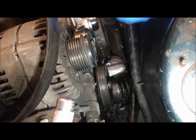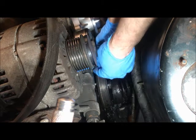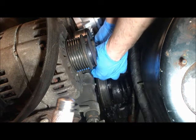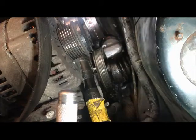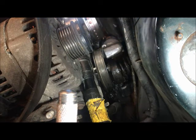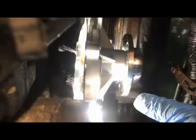Just lift the pump into place and start getting the bolts in. Make sure the gasket stays where it's supposed to stay. I placed a flashlight in there so I can see inside the pump, just making sure all the bolts are going where they are supposed to go — especially the small ones. You can see through to check if the bolt went through the gasket or not. Once I have them all through, I will go ahead and tighten.